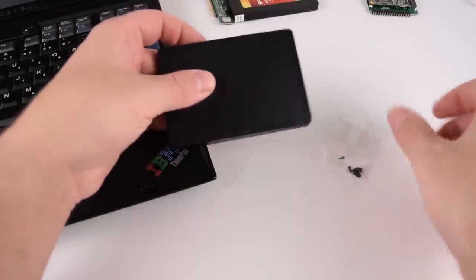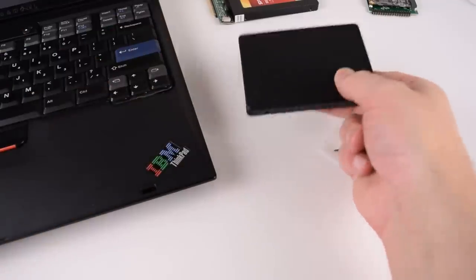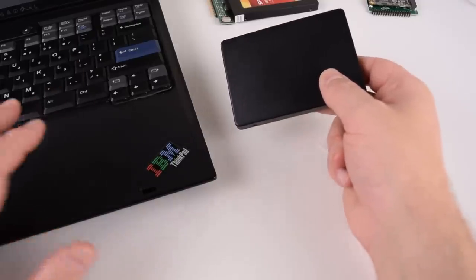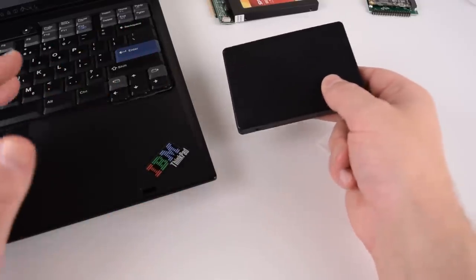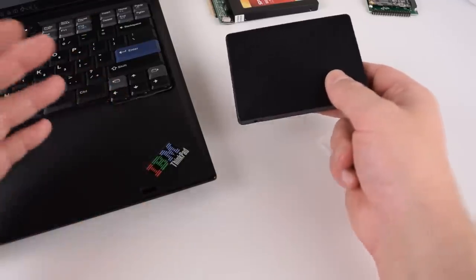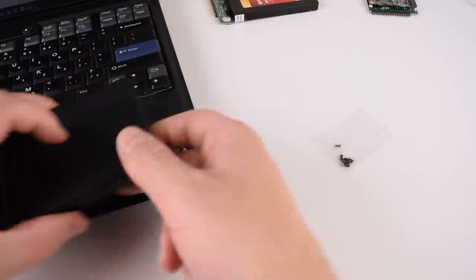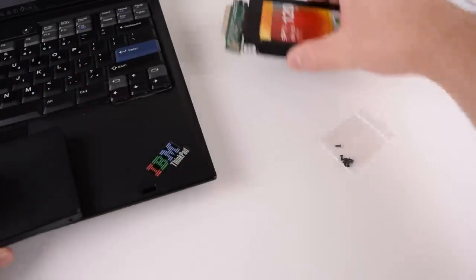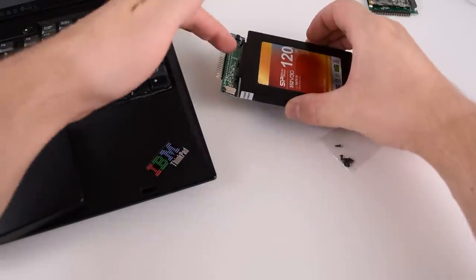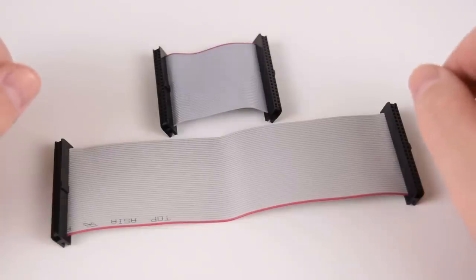There's also a little bag with mounting screws so you can easily install it into your retro laptop. Not all of the storage devices in this video will actually fit into a 2.5 inch drive bay — some have alternatives I didn't buy because I don't work much with laptops, and others simply won't fit. For example, you physically cannot install a 2.5 inch hard drive with one of these SATA to IDE adapters.